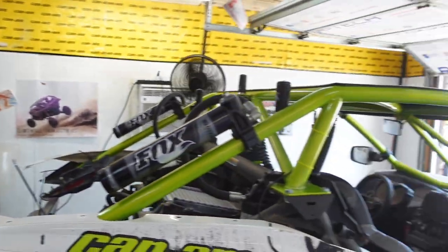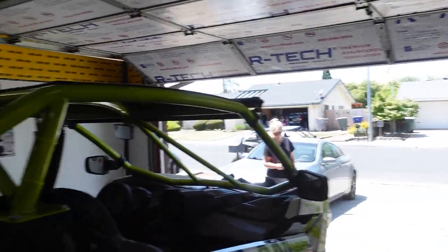Right? All right, so we're going to take this thing for a little drive and put some real boost to it. So far, we fired it up. We let it warm up. It got heat in the radiator. The intercooler and turbos hooked back up. You revved it. The blow-off valve let some pressure off, so it was obviously building a little bit of boost.